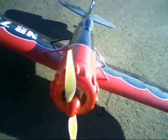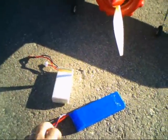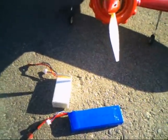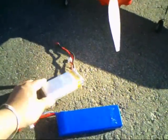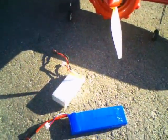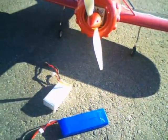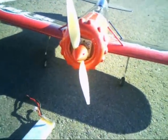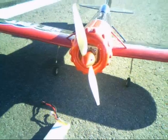I've got it on two of these batteries — one is a 3000mAh and the other is a 3300 Zippy. They're both Zippys. I'd much rather have it on the 3000. Runtime is pretty good and it's 2 oz lighter. 2 oz seems to make a whole lot of difference, and on this plane with the 3300, AUW is about 39 oz.